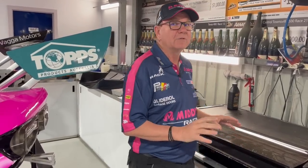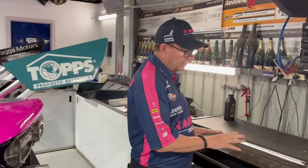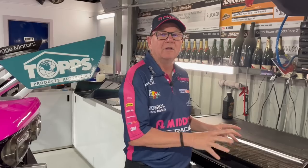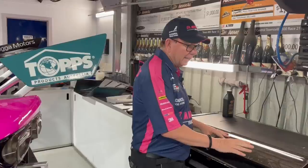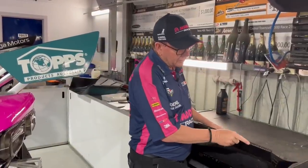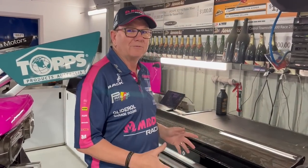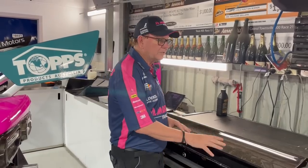His driver at the time in an Indy car was Bobby Unser. They put this little lip on the back of the wing because he just thought it would work. Bobby went out and ran the car around, and he was slower than he was with the real wing on the car. So when everyone had left, Bobby said to him, 'Look, that really worked well — it had so much understeer it wouldn't turn around the corners. If you put it on the front as well, this thing's going to generate a lot more grip than it did with the old wings.' Dan Gurney didn't want to hide it too much because it was easy to see, so he told people he put it on there — so when you pushed it, you weren't up against the sharp edge of the wing. It took people a long time to work out what he was doing, and it was very effective.